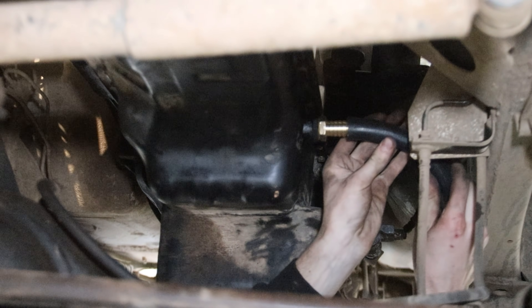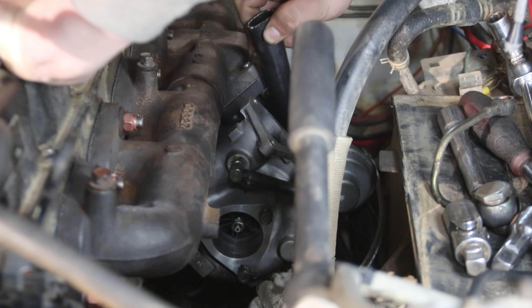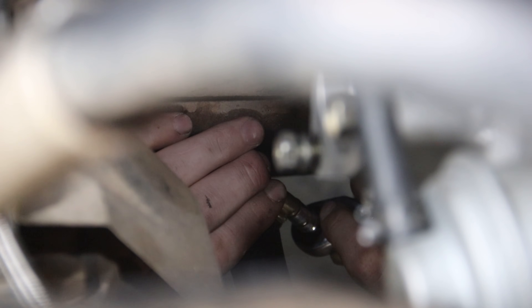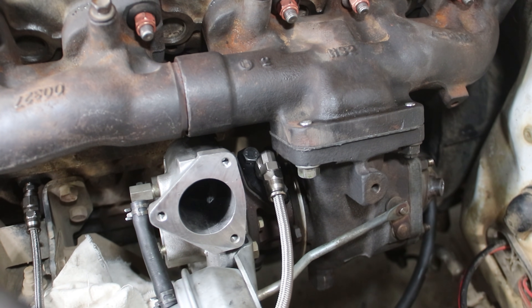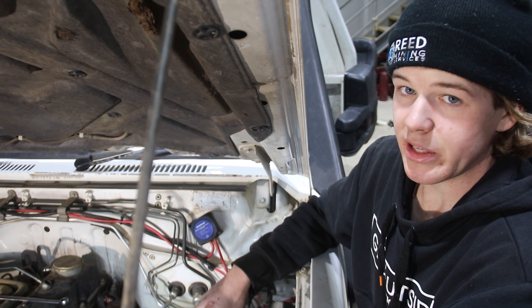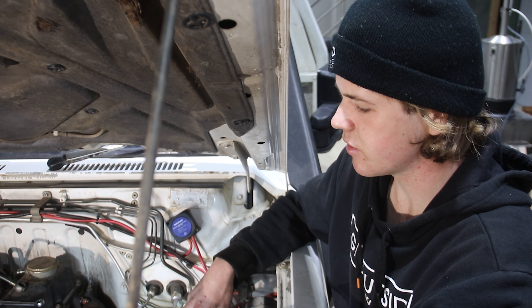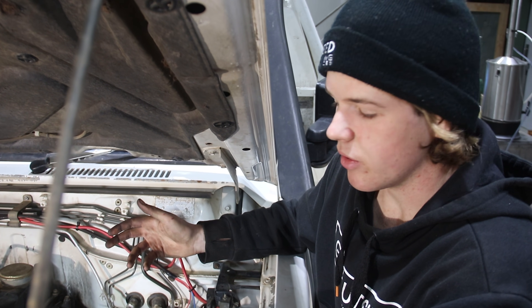Hopefully that's not going to be too bad an angle for the hose — should be fine. We cut the drain hose down to length, put some hose clamps on it and it all fits good. Oil feed is done. Worth noting: a lot of people don't run water cooling on these — you could just oil-cool them. The non-intercooled models actually came out with water cooling in the early GUs, and then the TI models in the later GUs ditched water cooling altogether, just running oil-cooled.